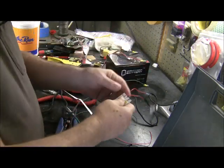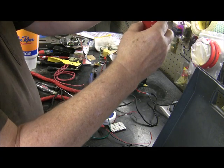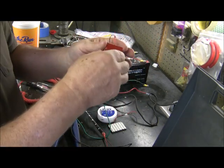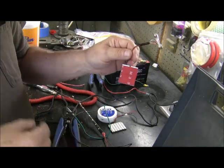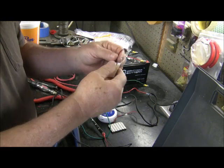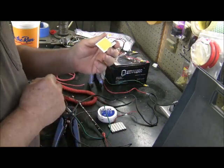They're real easy to use. These here, for over the plate, you have to mount it up on the inside and wire it to the same line that you've put your red lights on, if you're using vent lights. If you're not, just hook this directly to your parking light side of your marker lights or your brake lights. Wires, not the brake light side, but there's two sides to that, and I'll see if I can't show you that too.